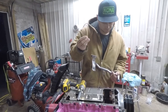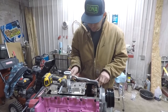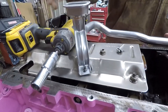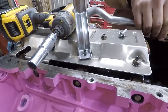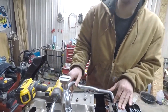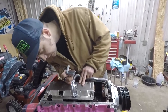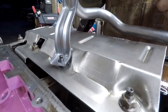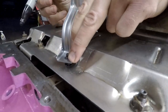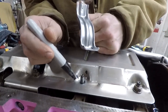It seems fine... uh oh, wait a minute — we have a problem. I think we may need to make a little adjustment. I'm going to notch this windage tray just a little bit right where it's hitting. It's right out there and then it's probably going to hit down here too, so we'll have to notch that out. I'll notch that and come right back.